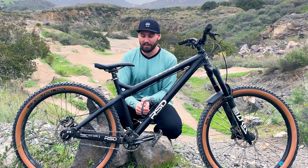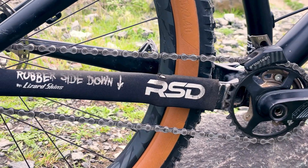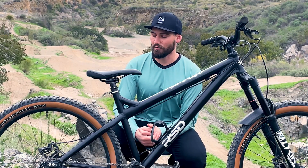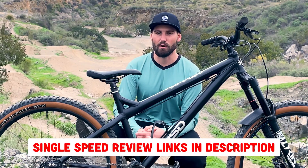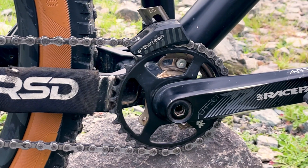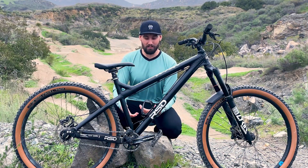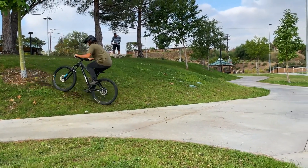I believe the playful nature of a bike has just as much to do with what's on it as what's not on it — and as you've probably seen, I run a single speed setup. I swapped over to single speed about three months ago and I've really enjoyed it. It makes mountain biking simpler, feels like the old days of riding a BMX bike, challenges you, pushes you out of your comfort zone, and keeps mountain biking fresh. I also run an e13 chain guide — I like doing fakie tricks, and when you're pedaling backwards the chain really likes to derail. The chain guide keeps things secure and prevents unwanted chain drops.